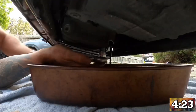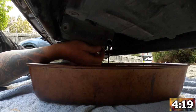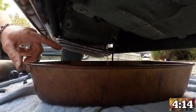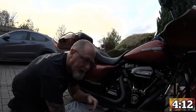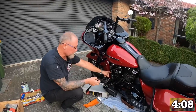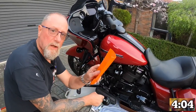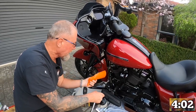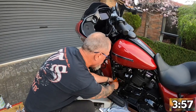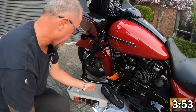And the second one. You can see how it's a lot cleaner — that's the transmission fluid. While we're waiting for them to drain, we'll whip around the other side and take the oil filter off. The oil filter is located at the front of the engine — that's why you need one of these, because when you take it out it's going to spew oil everywhere. This goes underneath the oil filter, push it to the back, and it'll drain straight down into the pan.